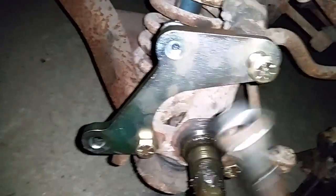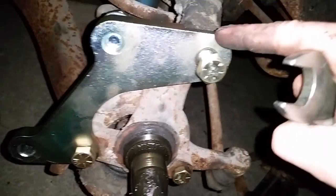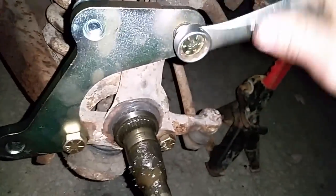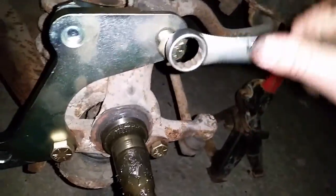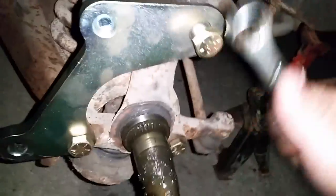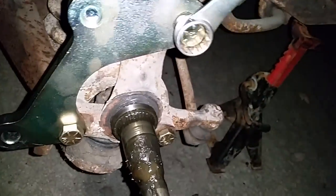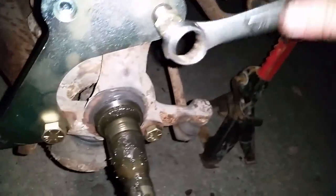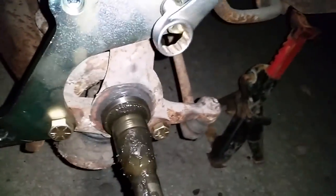Here's the Core 3 kit. If you tell them what size upper anchor bolt you have, it'll come with that upper anchor bolt and a little spacer. This is a universal kit — unlike the Classic Performance kit. This is a straight C5 kit, not a C4 or C5 hybrid. The difference being a C5 kit will require you to turn down your hubs.